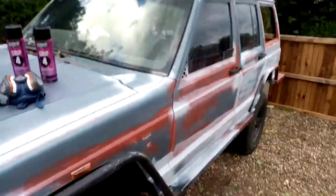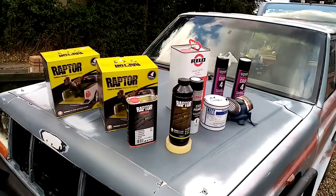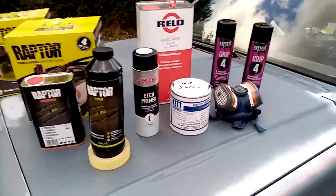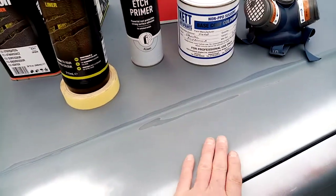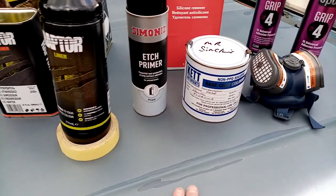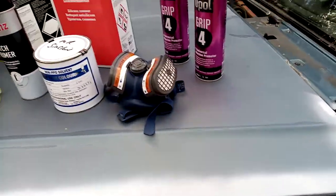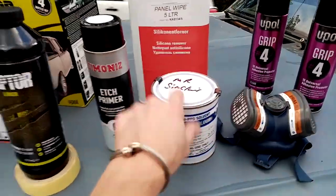This is part one. What you'll need — I think I'll need eight litres, two kits. Like I say, it is tintable and you can spray it. There is a purpose gun for it, like a Schutz gun, but I'm going to attempt to paint it with an HVLP gun — high volume, low pressure. I have drilled this nozzle out to 2.5mm to take the heavy Raptor paint coat, and I should be thinning it down 10% first coat and then 10% the next.